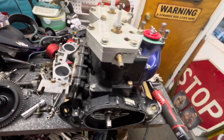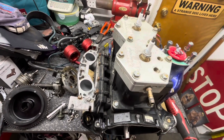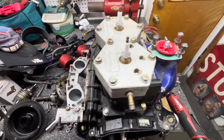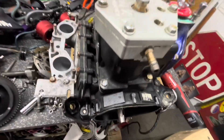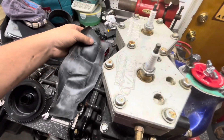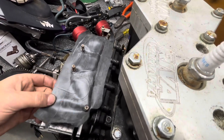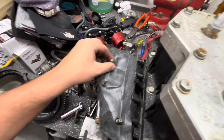For the next step, I did spray that with some Simple Green just to show you there was a lot of oil. For the next part, you take your carbs off. What I did was go to Home Depot and bought a two-inch plumbing plug and grind it to fit the manifold, then use that to seal up the intake with your spark plugs tight in the cylinders. The other thing I did was take an old BMX inner tube and cut holes in it to size, stretch that over where it needs to be, then put your carbs back on and tighten it up.